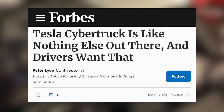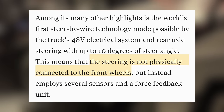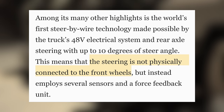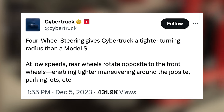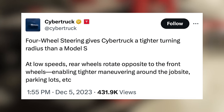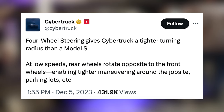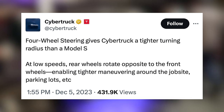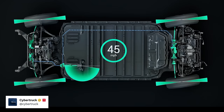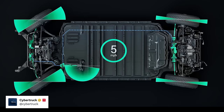Steer-by-wire fundamentally changes the way that the car's steering is handled. Here, the steering wheel is actually not physically connected. Instead, the connection is made electrically using a wire running from wheel to axle. When making a tight turn, the Cybertruck does not require you to turn the wheel hand over hand, but will stop after one turn. This system allows for a more versatile driving experience that adapts to the setting that you're in and the speed you're driving. When driving at higher speeds, it feels like steering that you are used to, but at slower speeds, you can make tight maneuvers easily and precisely as it requires less to get more.